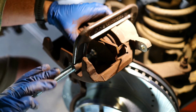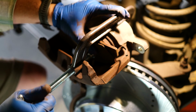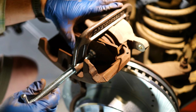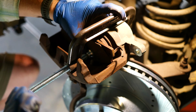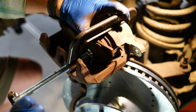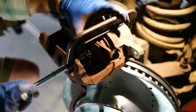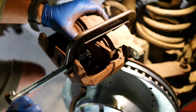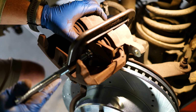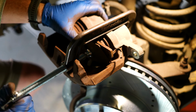Okay. On newer models, you don't necessarily have to remove the cap on the master cylinder. That's because the cap has an expanding diaphragm in it that takes up space as the fluid goes down, and then it collapses as you push it back in. If you don't have that in your brake fluid reservoir, you might open the cap so that it can push back up in there.